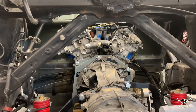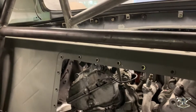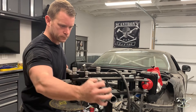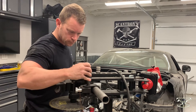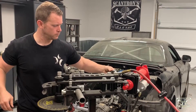Here it is all installed and fitting in beautifully. I have a suspension crossmember already in there bolted to the frame, so everything is squared and leveled. Now we just need to make a crossmember. For the crossmember I'll be using inch-and-a-half DOM tubing with a 120 wall thickness. To bend this I'm using my JD Squared tubing bender, and I'll just be putting in a 40-degree bend for this first bend.